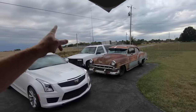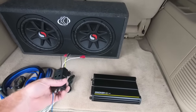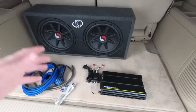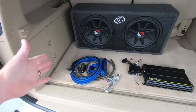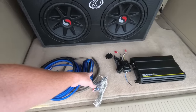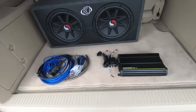And if I don't sell the two-door Tahoe, I will make a custom system for it. But the only things I actually had to buy — I actually had this from an old Tahoe before — this is a line converter, so we can tap into the factory radio because I am going to leave it for now. It's kind of cool because it does have an adjustment knob so you can turn it up and down if you want to not listen to bass. The only thing I really bought new is wire, and I just bought a kit — it's a Kicker kit, four-gauge wire, I think 12-gauge speaker leads, and then it comes with your RCAs, the fuse and fuse holder, the amp turn-on, and a couple screws and zip ties.